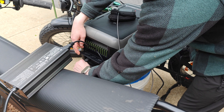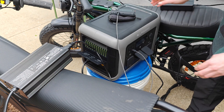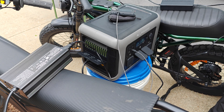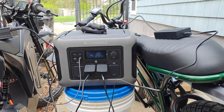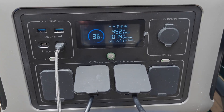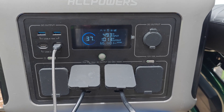Something pretty cool about this unit is that if you do have it plugged in, it acts as a UPS, or an uninterruptible power supply. So in that mode, anything you plug into this is essentially getting the power from the wall, which decreases the load and extends the lifespan of this unit. But the key advantage here is that in the event of a power outage, this can within 15 milliseconds switch from the wall power to the internal battery, keeping your devices going in a sudden power outage.